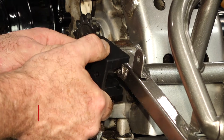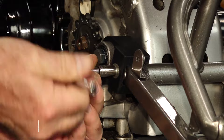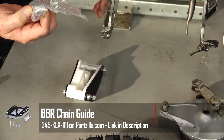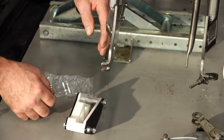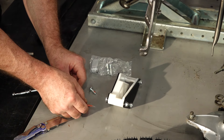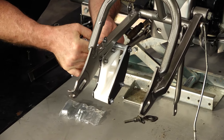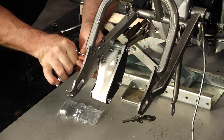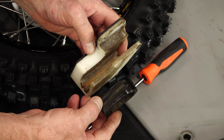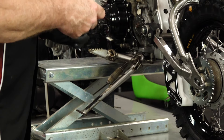Now while we're at it, let's go ahead and replace that swing arm protector. This unit from BBR is used on several different models and it comes with a spacer — I'd assume for a TTR or a CRF — but for this application we won't need it. They recommend using Loctite on these new bolts, and that's what we're going to do. They even send their own Loctite, so we'll use theirs. Now let's get the new bolts on our new adjusters — don't forget your washer. Go ahead and get a little grease on the axle just to make it easier to take out next time.